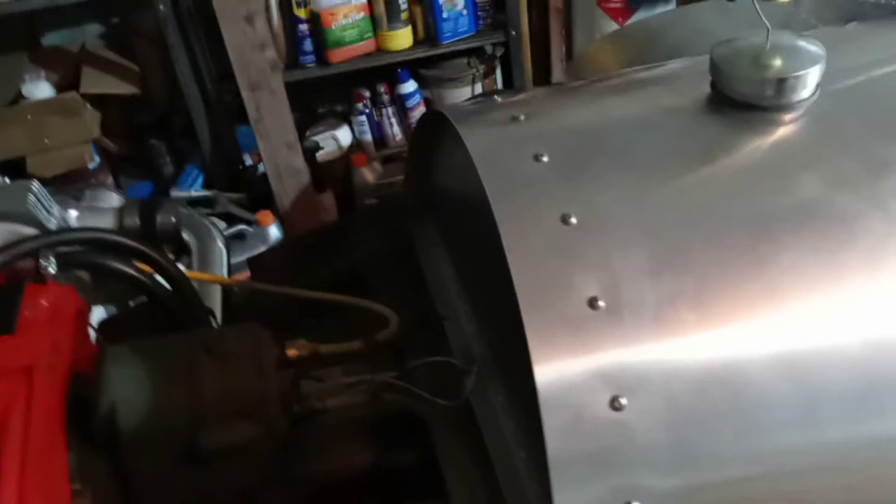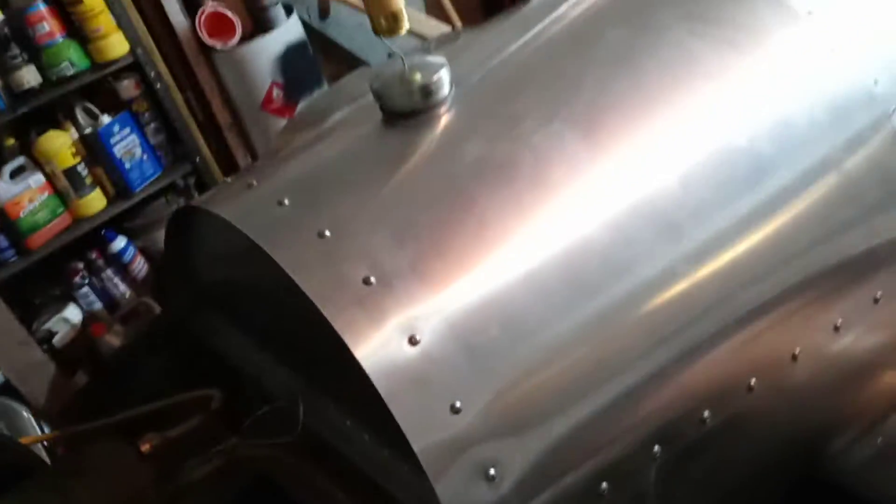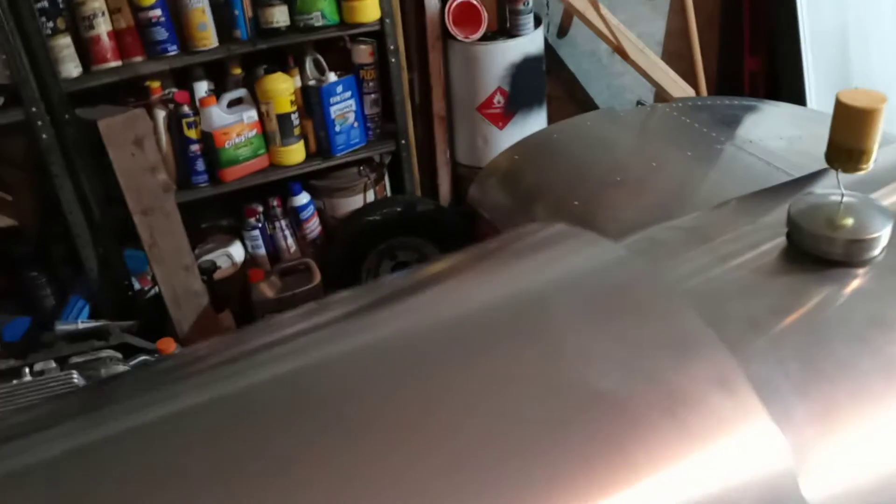What I wanted to show you is that I got the tank cover on all the way. I don't need to take it back off — well, of course I got to put nut plates in here for the cowling. I brought it out right there and it doesn't have holes in it, but I also got to trim around the intake tubes on it, and of course I've got to get the nose bowl fitted before I can do this cowling.